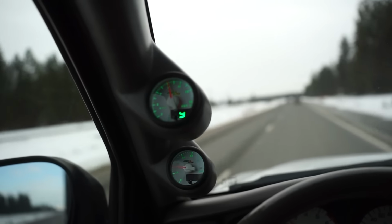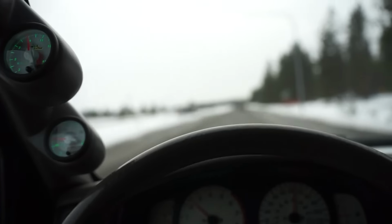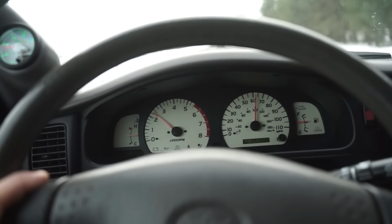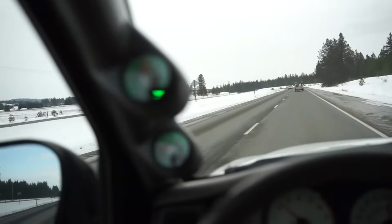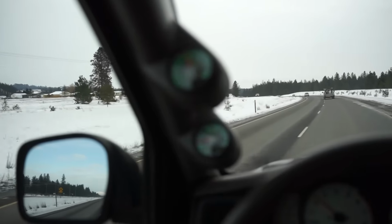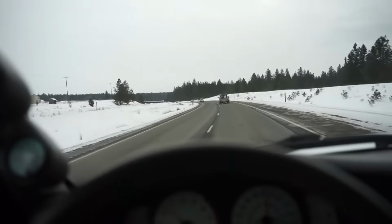You see, 930, it's dropping off a little bit. It's a little more flat right here. But all in all, this thing has got plenty of power to pull a trailer. I think the biggest thing with the TDIs in these trucks is the exhaust temp. But really, it so far hasn't gone much above like 1200 degrees on a hill. There was a decent hill back there, only hit about 1100 degrees, so really not too bad.